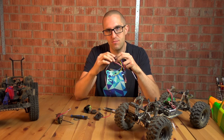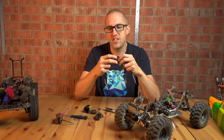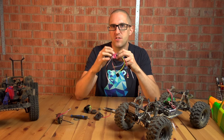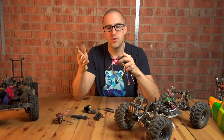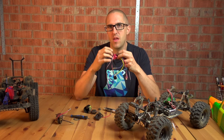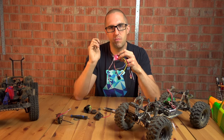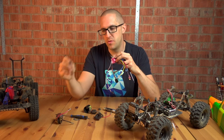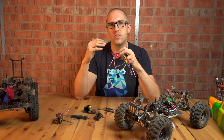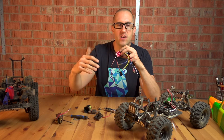The downside of brushed motors is the feedback to the ESC. Certain ESCs like the Charisma Arc 2, and I think some of the other high-end ones like the Holmes Hobbies ESCs, look at some of the feedback that comes back from the motor in terms of how it's absorbed those pulses, in order to do some clever adaptive drag brake stuff.